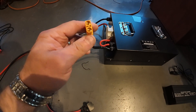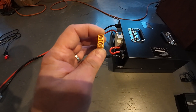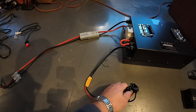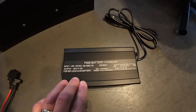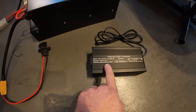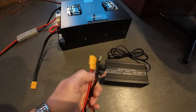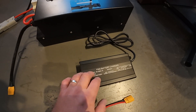One more plug comes from this battery pack. This plug serves two purposes: number one, you can get 65 volts output from this plug if you wish to connect special accessories running on 65 volts. It is also possible to charge through this plug, and the factory did supply this plug — but I do not recommend using it until you buy a dedicated charger with the same shape. Your original charger has exactly the same plug that would fit this socket, but do not plug it in, because the original charger is for lead-acid batteries only. It will destroy your lithium batteries.